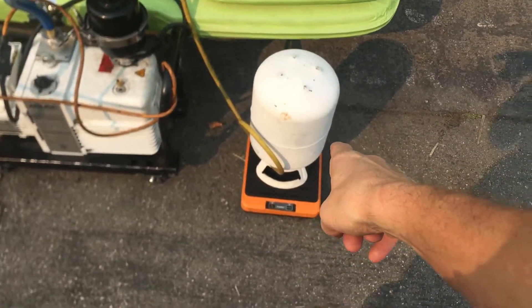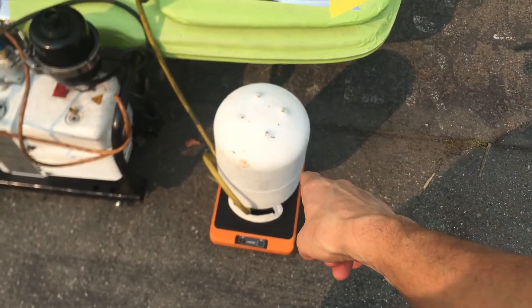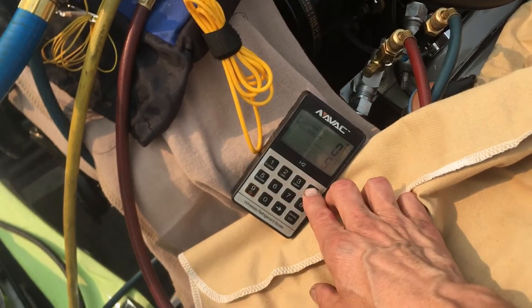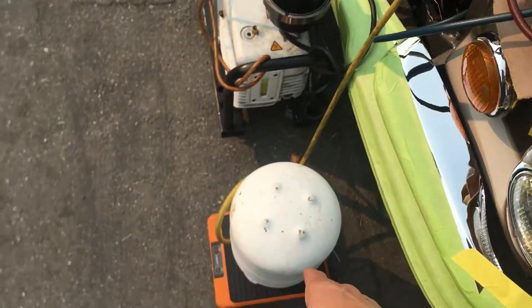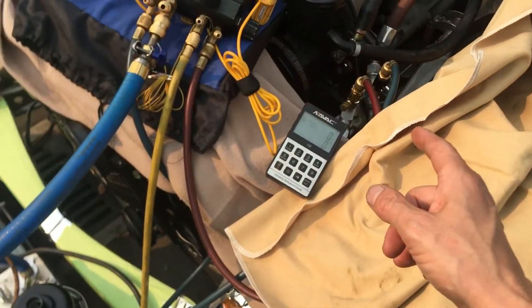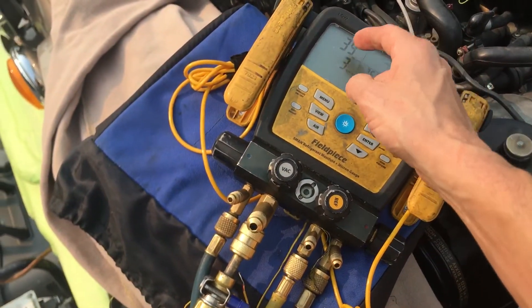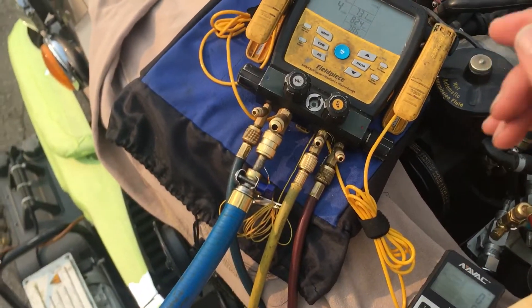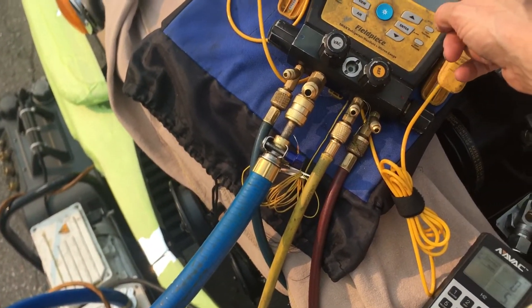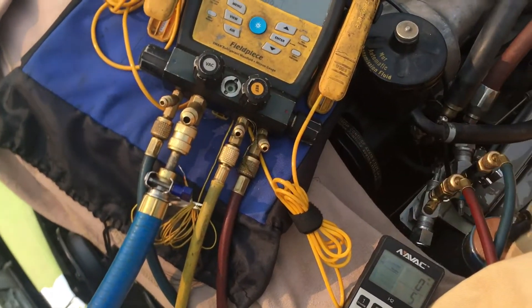It's that time to fill it. As you can see, I have my R12 tank — and that's only a 10-pound tank, not a 30-pound tank. Let's zero out the scale. This is an 800-gram system of R12, and R12 is going back inside of it. I now have the system down to 39 microns. I think we're pretty good, even though I'm reading the level at the gauges and not on the system.